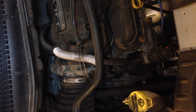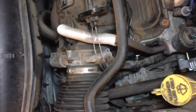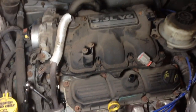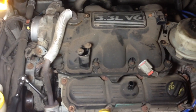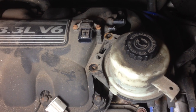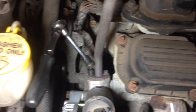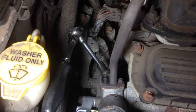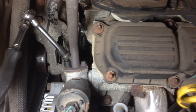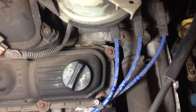We've decided to do the intake manifold. I've taken off the air cleaner and the throttle cables — those two bolts there — and undone the two bolts for the power steering pump reservoir, and taken off the vacuum hoses. I also want to show you these two bolts here for the EGR — you should take them off by hand. I was able to crack them free with my tool, but avoid air tools on those ones so you don't damage the threads.